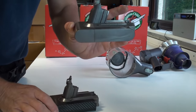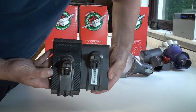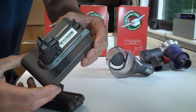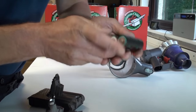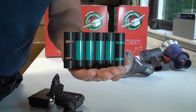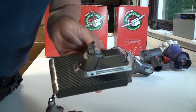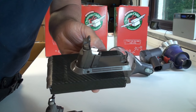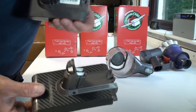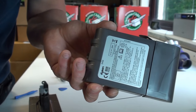What we're going to do is convert this battery into one that looks like this - just a little bit bigger and heftier. Side by side you can see one is bigger than the other. The original battery has six small cells in it - a pack of six 2,000 milliamp hour lithium ion cells - and we're going to replace those six with six 5,000 milliamp hour cells, reforming the plastic component so it looks like a finished product rather than a prototype.